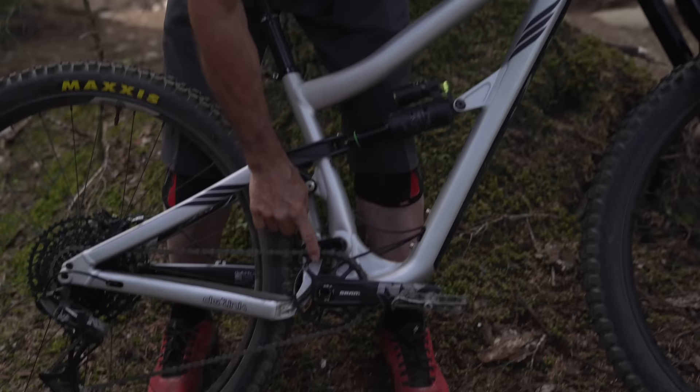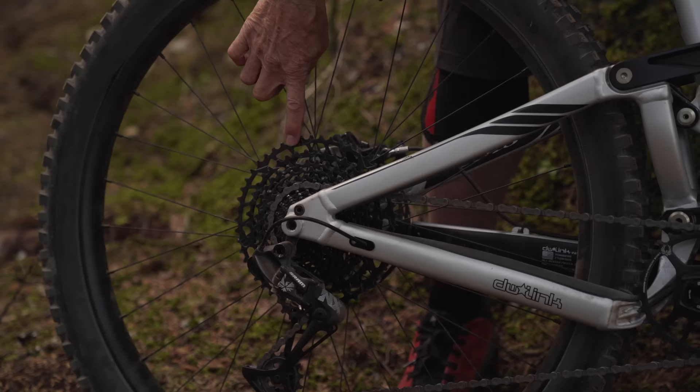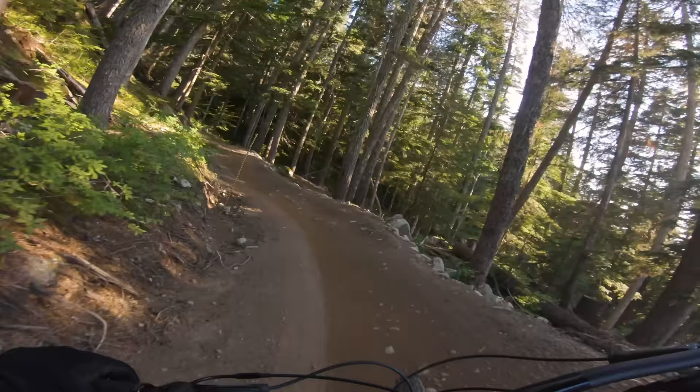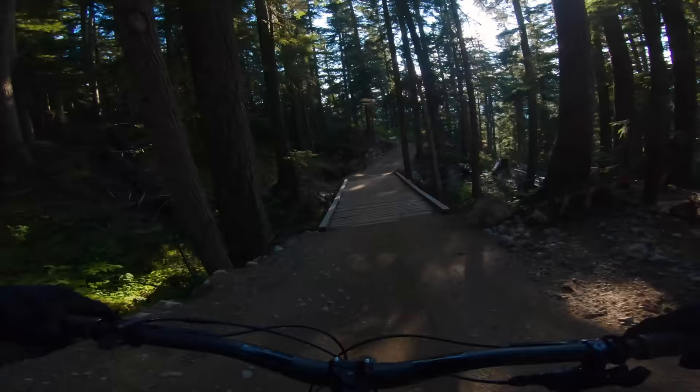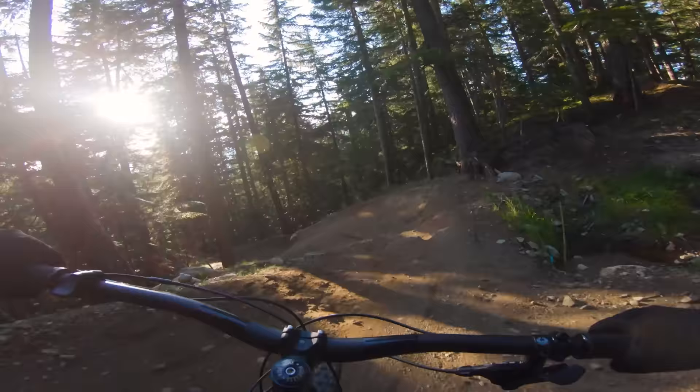You've got to make the savings somewhere, and as you can see this is a pretty high quality frame. So in the components we stepped down to NX — this is SRAM's 12-speed, but it's not the 500 range that we get in Eagle. This is an 11-tooth sprocket, giving us a little bit less of a spread, but we still have 12-speed and still have the 52. If you're a gravity addict your high-speed runs are coasting anyway. NX isn't the greatest component group but it's the lowest you can go in the SRAM Eagle 12-speed range while still having the reliability and smooth shifting you need.